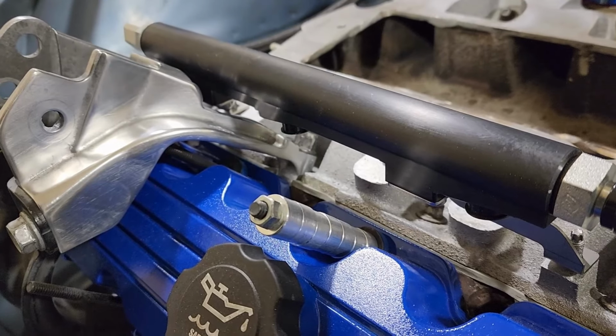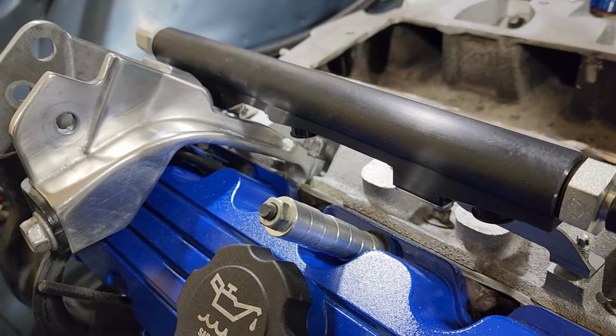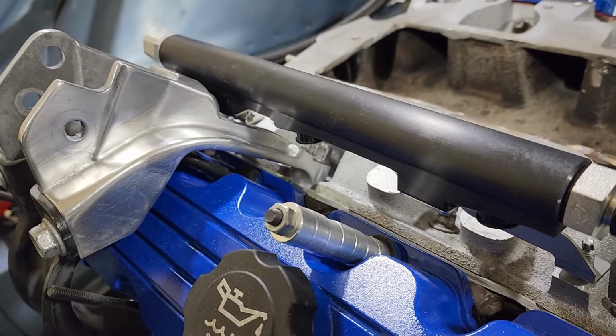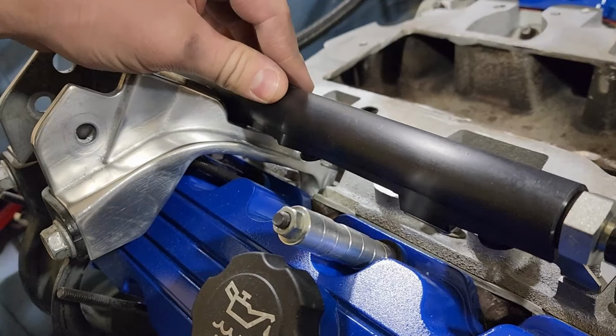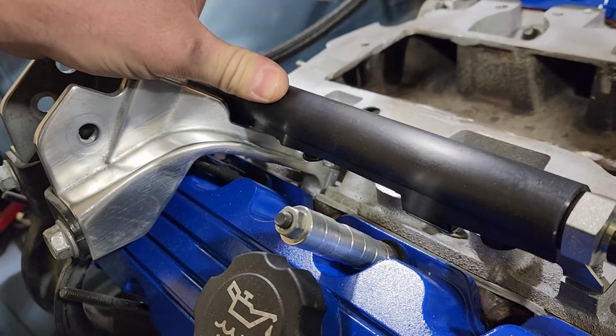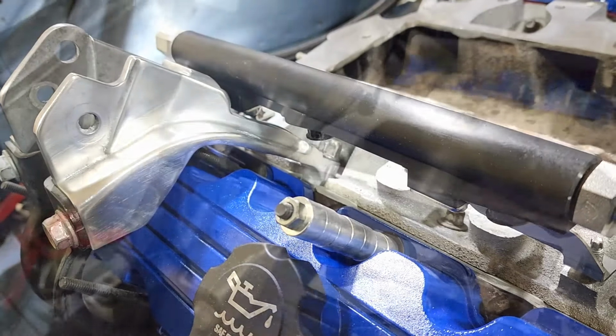Typically, you want to make sure things aren't hitting each other and vibrating to cause false knock to appear in the sensors. So I just keep that in mind. Every time I do something, I want to make sure things are not touching itself unless it's bolted together. If it's close, it needs to have an air gap. I think we're good with this one there for now.